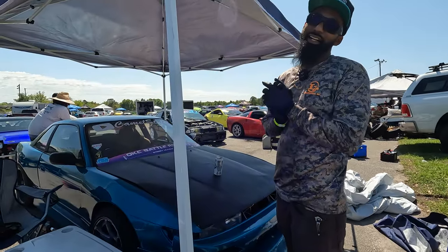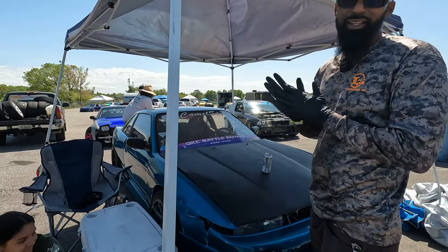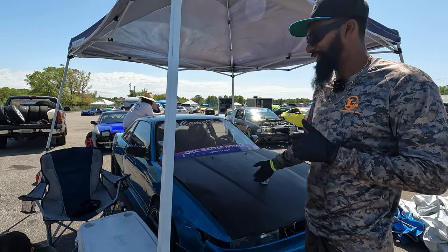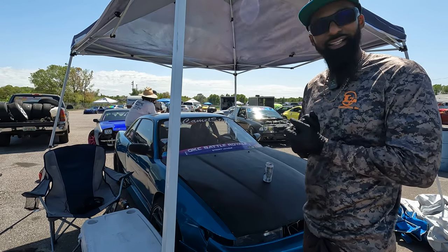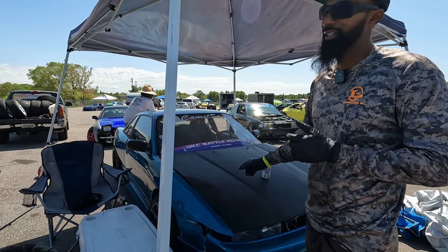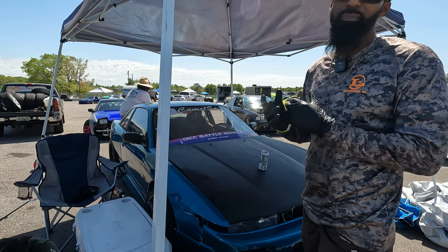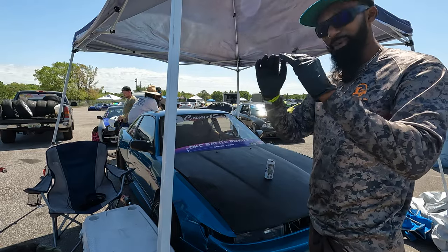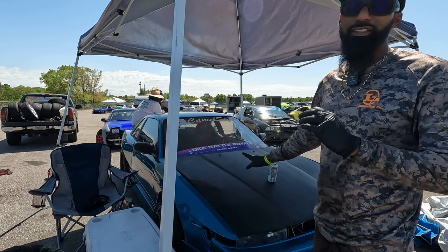All right, so it's the third day at Spring Break Bash, and pretty much both my cars decided to break. We had Old Faithful. I had an SR in this thing for about 11 or 12 years, untouched. I didn't have a failure due to the SR, like everybody likes to hate on, but it leaned out and I ate a plug. I got low compression on cylinder number one. So I'm probably gonna have to take it apart, and I'll probably try changing the piston if the wall's not messed up. If the wall is messed up, I got one more block that had a rod knock. I'll just pull everything out, put everything from this one back in, possibly put my billet head on while I'm there, and then hopefully be back up to running with the least amount of money spent.